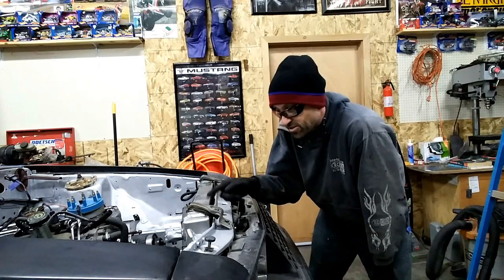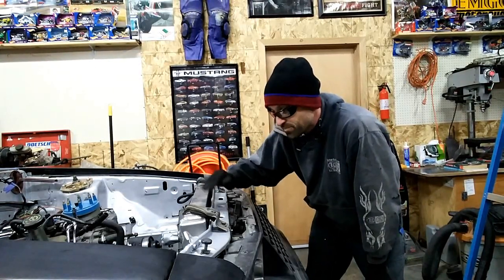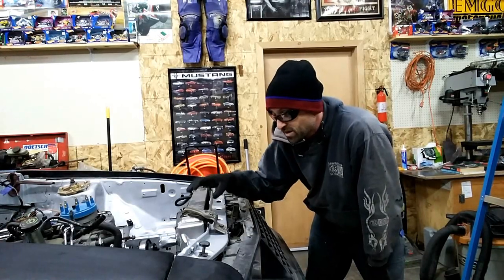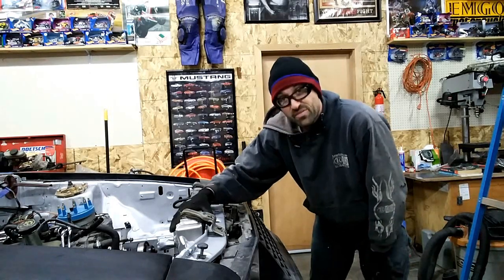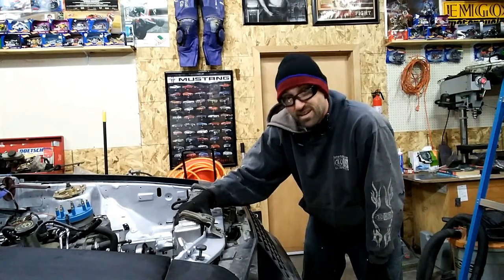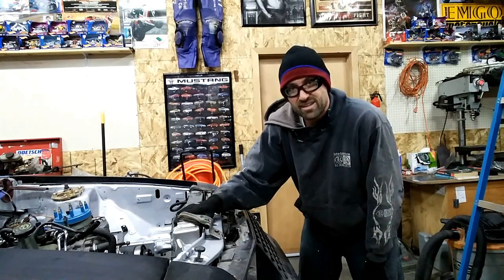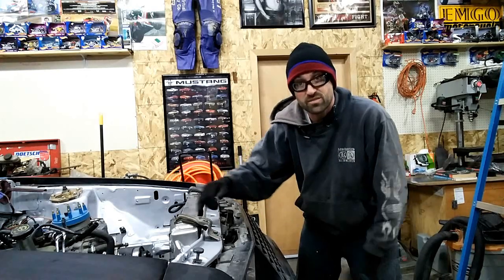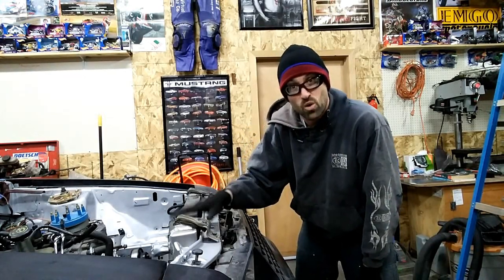This radiator — the hold-downs are not going to fit under the hood. It's a B-Cool, I think either a 3-core or 4-core, that I got out of the 92. What I'm going to do is buy a cover that bolts here, goes up and over, and mounts the radiator. I had thought about bending it myself with 2x4s and a hammer, but I just don't think it's going to turn out, so I'm just going to spend the money and buy one. I may also have to lower this on the Team Z piece because there's an aluminum piece that's actually pushing it up, so I'm going to have to modify something — I just don't know what yet.